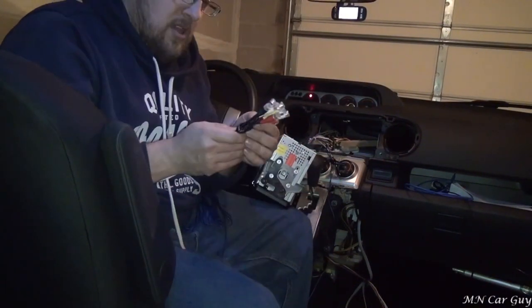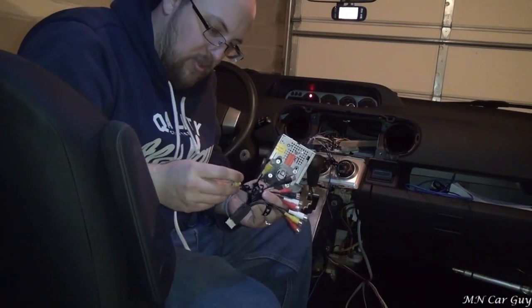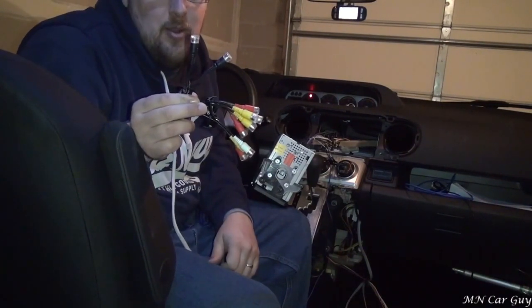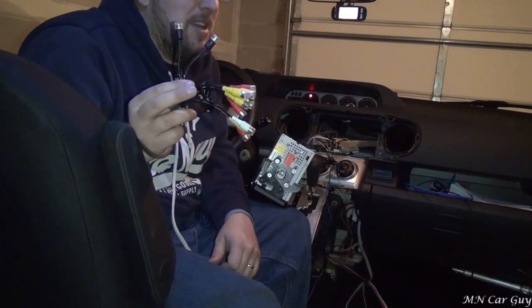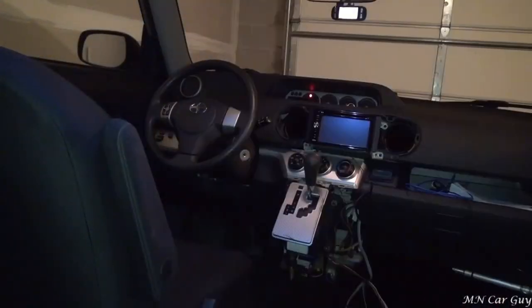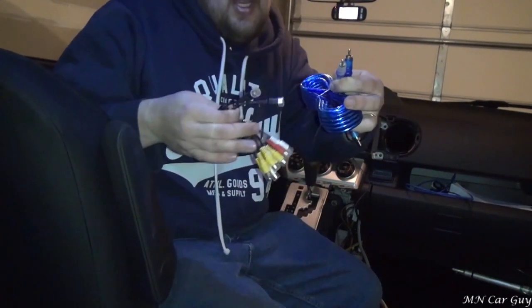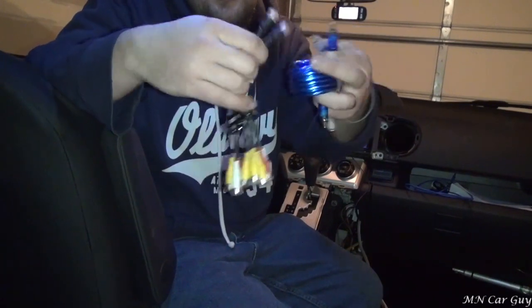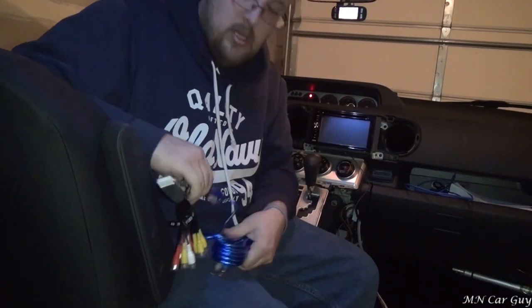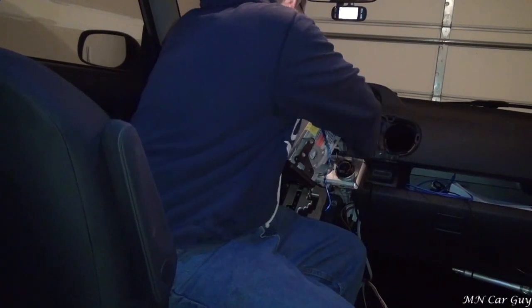There is this monster connector and it has pretty much everything you need. You could do RCA inputs and then it has video output and the camera input. And then here's a pair of subwoofer outputs — I think it's interesting to note that they're both black, and I'm going to assume that means they're not splitting it between left and right signal — they're sending both straight to the back of the unit. So I'm going to grab the RCA cable that's running into the back. This one's got the RCA style hookups and it's not going to matter which one matches up to what because these are not colored — they do not differentiate between right and left. So now I've got it plugged in on this end and this end will run through the car and connect into the amplifier. I'm going to thread these back down through the dash.